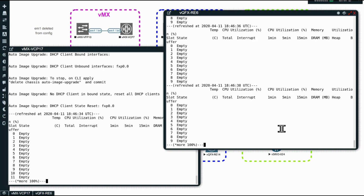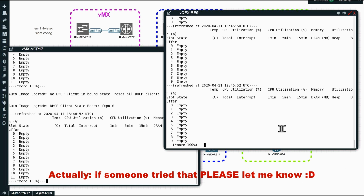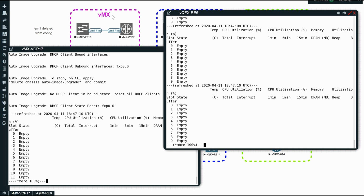I mean, you wouldn't open your QFX hardware switch, desolder the internal interfaces, and route them over another switch just because you thought, well, I like that, this is a good idea, because it is not. Because think of those two images as one device, and that's your internal link. That's why it's called int for internal. You don't want to put your int link on some layer 2 network. That just feels wrong.